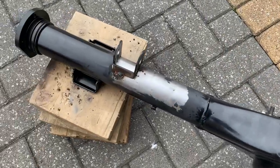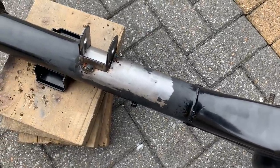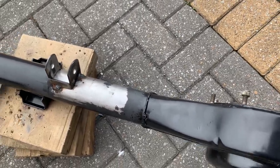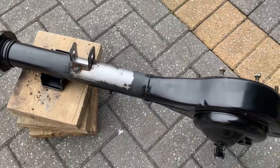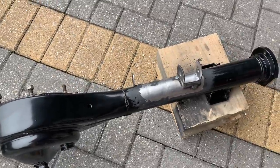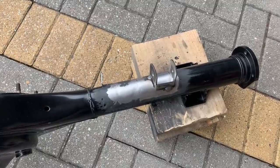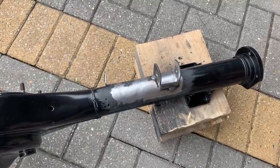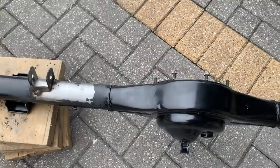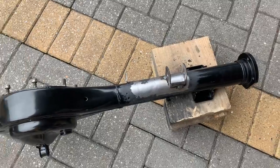We're all tacked up. Something I learned from watching one of the YouTube videos — I think it was Trev's blog, he's an absolute expert when it comes to fabrication and welding. He said if you want to lay down a nice even weld all the way along and you've tacked something in place, knock the tacks back first. Grind them, not all the way back so you lose your holding strength, but just knock the tops off them, and then you can weld basically right over the top. So that's exactly what I'm going to do — run a nice continuous weld all the way around.